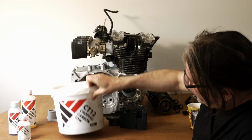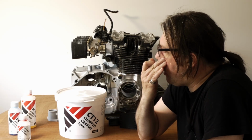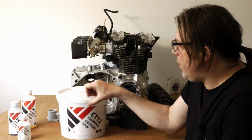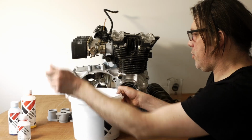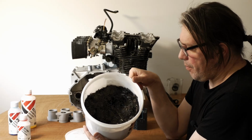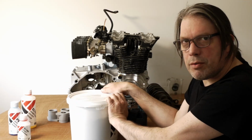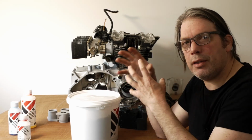And basically, you make a mold. Loads of ways of doing it. One way is to 3D print it in PETG. So you make a mold, you fill the mold with this stuff. This is what they call chopped tow. It's chopped strands of carbon fiber, and it's dry carbon fiber. And then you alternate filling the mold with your pre-mixed resin and your carbon fiber until it's full, and you have a calculated amount in there.